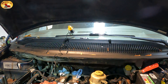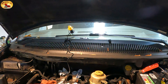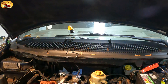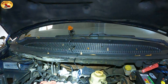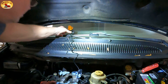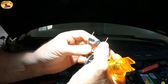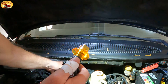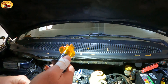That's a no-go — that's number one, which we were having problems with. Now we'll test three — nada. Now we're going to test five, keep your eye on the little light up there. That is the slickest thing since sliced bread, just like I told you. I turned the shop lights out so you could see it better. You can stick that anywhere you want, and it just swings out to any size. I now know it's either the plug, the harness, or the ECU.